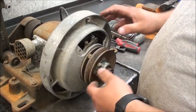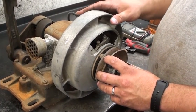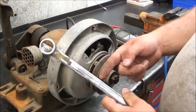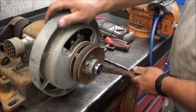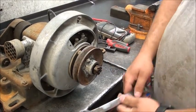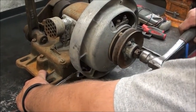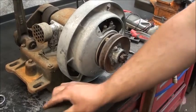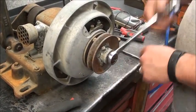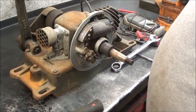Here we have a barn-fresh Maytag as we found it, missing a couple of parts, but that's not a big deal. The first thing to do is check the coil for continuity to know if the coil is even good. The easiest way to do that is to remove the flywheel nut here. You'll need a 15/16 wrench and loosen the nut up until it's flush with the outside edge of the crankshaft. Then stick your wrench in behind or a pry bar, hold some pressure and hit the nut, and as you can see the gap is gone and the flywheel slid out. Now we'll finish removing the nut and the flywheel assembly will just slide off completely.